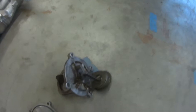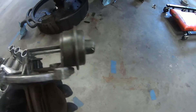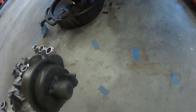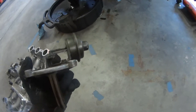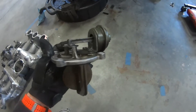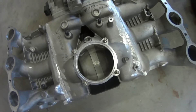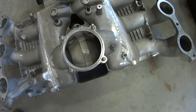Here is a factory iris valve. It's got an actuator much like a wastegate, and it's got vacuum actuation so it will just open and close this valve. Normally it's closed, and then under high load at a given RPM it will open up and you'll get a little better air flow across the intake. Basically it goes right in there and it's normally blocking off this area between both intake runners, and then eventually it opens up.